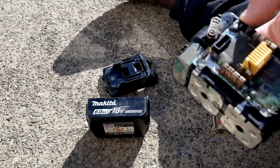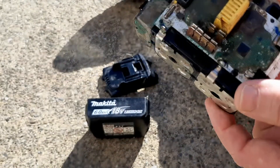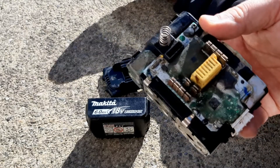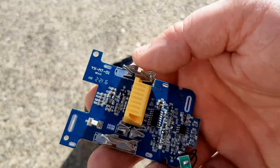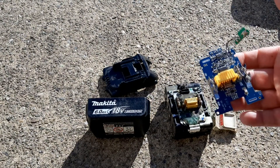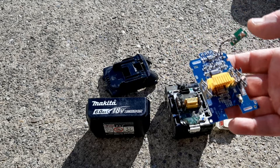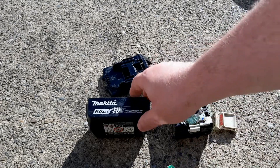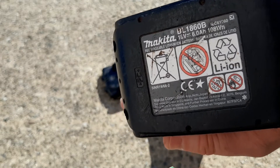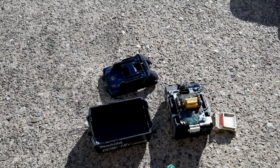What I have to do is desolder all these connections to get to those two screws — one at my thumb, one at my other thumb — and desolder all these connections around here, then put in the new board. This is the new board; it looks slightly different than the old board, but it's similar enough and the connections are where they should be. When buying a replacement board, be very careful and refer to the actual number of the battery. This is a BL1860B. Inspect the circuit board and compare it with what you're buying, especially if you're buying online.